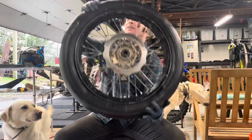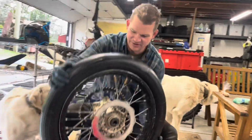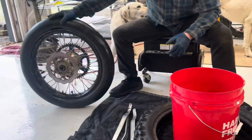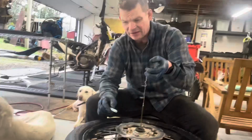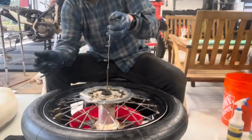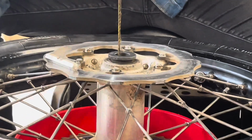Lucioli, look how heavy duty this thing is. This is the tube. It's no wonder the instructions actually tell you not to run their tube without a tire. You could actually drive on this thing. I balanced these. I put a little lightweight aluminum gun sight level on the brake rotor, hang it from the ceiling, and you can balance them.